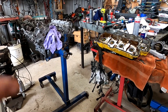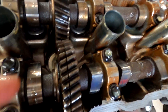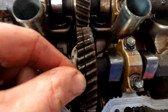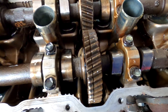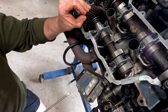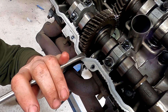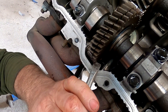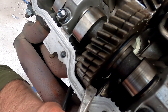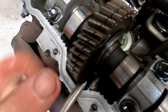I can probably get a screwdriver in quite safely and show the backlash on here. You can see that these teeth aren't quite lined up — if I just get my screwdriver in, I can wiggle that back just a little tiny bit. That's how it takes the backlash out, by pushing these gears against each other.